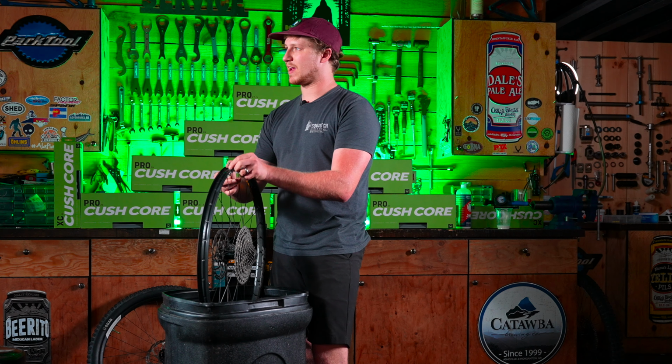Alrighty, using an injector is the cleanest way to do this without getting sealant exploded everywhere. It's almost impossible to do this with sealant already in the tire, so you're gonna have to push through the valve. In this case, obviously my valve core is out. I just have an open tubeless valve. I face the tire towards the bottom, and I push in my sealant.